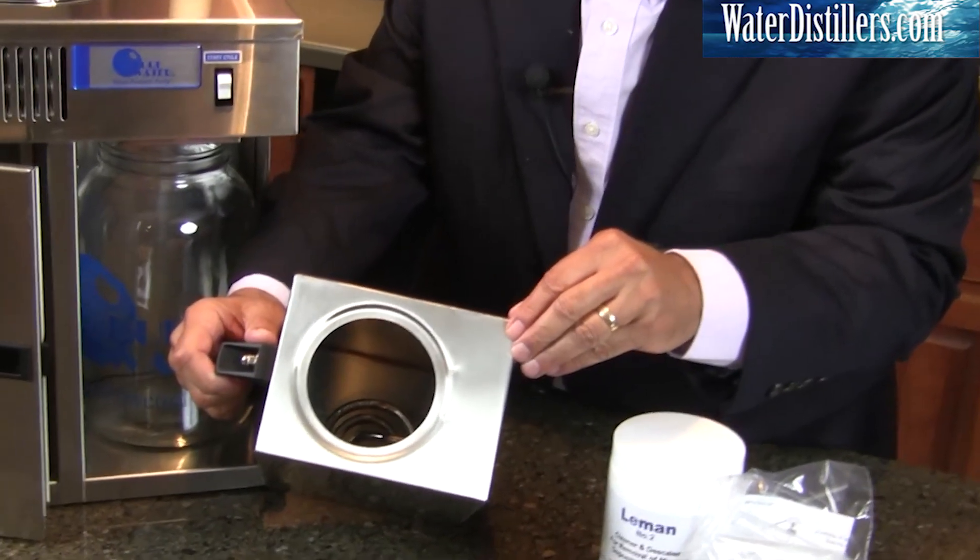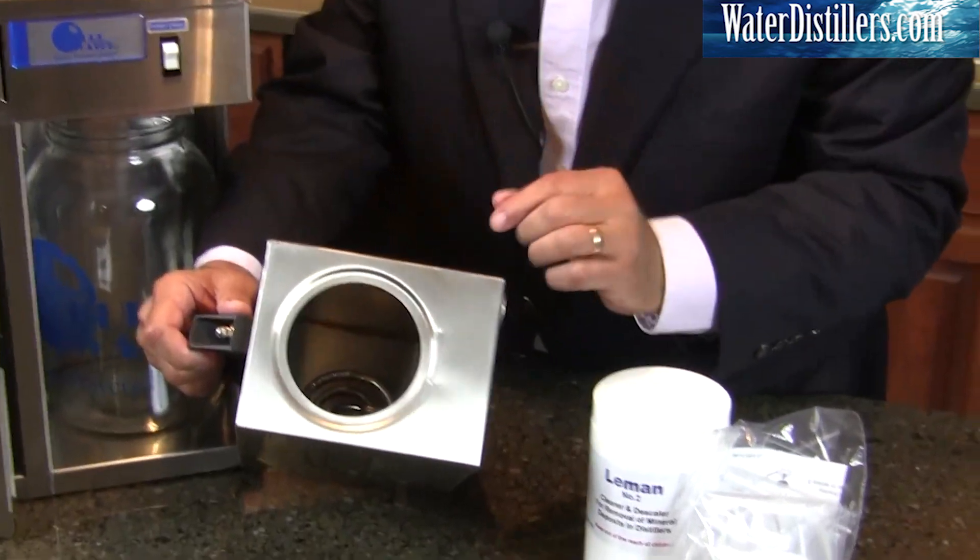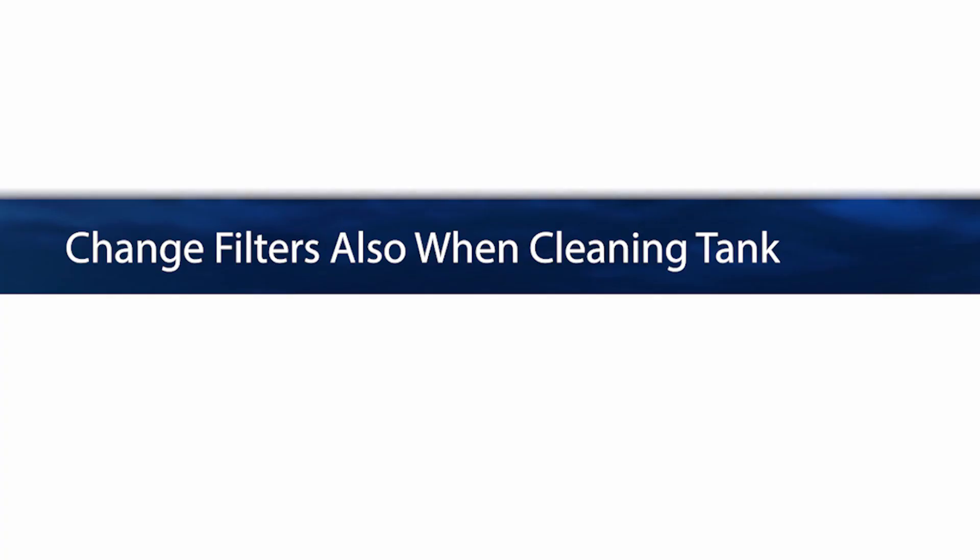You can do it through natural cleaners like vinegar, or you can use other chemicals which will work quicker to remove it. It's basically just making sure that your boiling chamber is clean. Look into it after about three weeks, see what's in there — make sure the machine is off — see what the buildup is, then clean it. Make a note of it and do it again. In mine, it needs to be cleaned basically once every six months.